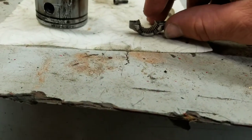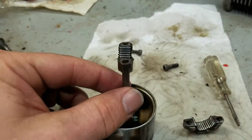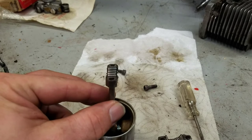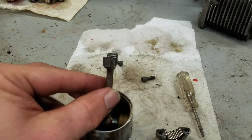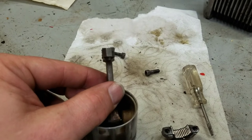The other piece I wanted to talk about real quick is the connecting rod cap. Make sure you get this into the engine and match the cap to the rod, and do it right the first time. Otherwise what will end up happening... you see the contour there?